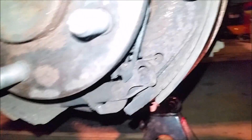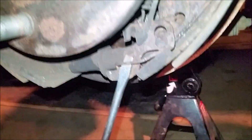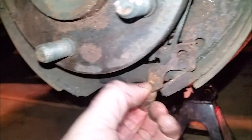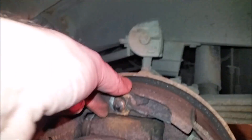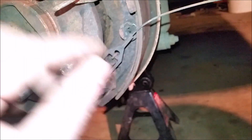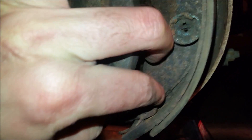I find the easiest way to get the adjuster spring off is to take a flathead screwdriver. This spring wraps around and kind of hooks down, so you just get the screwdriver under there and give it a lift. That's out of the way — this whole unit will flop around now. That cable connects to this little loop here. Now that that's off, you can fiddle around to get the cable out of the way — you have to get it so that it slides into there.